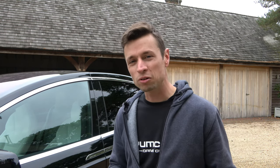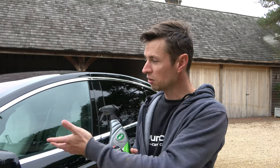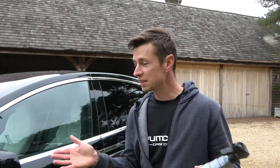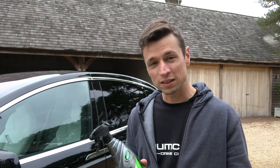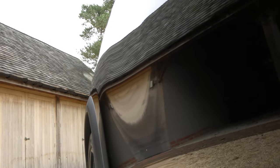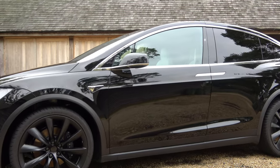Stick it out because you're going to get really good results — I think you're going to be impressed. The water test showed it just flew off, so in terms of protection it's really good, and in terms of glossiness it's really good too. I've only done one layer, so I don't know whether I'll get 12 months out of it. The bottle does say you have to apply another coat 24 hours later, which could be a real deal breaker if you're a mobile valeter driving an hour to someone's house — you can't easily come back the next day, especially if there's torrential rain or debris falling on the car if they haven't got a garage. Make sure you're clear with the client: you're guaranteed six months from one coat.